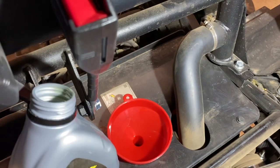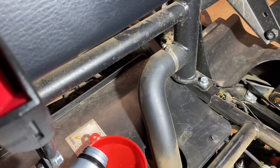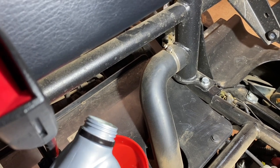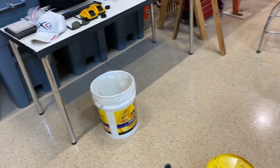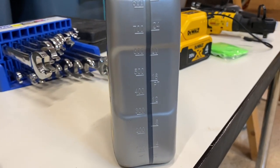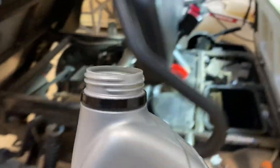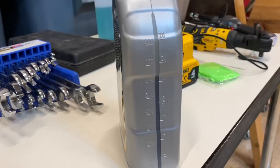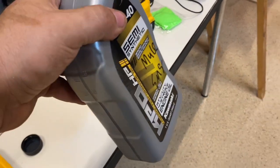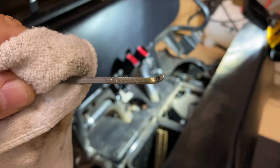These do not take a lot of oil — it's only 1.4 quarts when you change the filter, which we did. So I'm just going to be putting in just under half a quart and then a full quart. Looks like I've got a little bit to go — there we go, it's just about perfect. Now we'll check it with the dipstick — we're in pretty good shape, just under the full line, so that'll work.